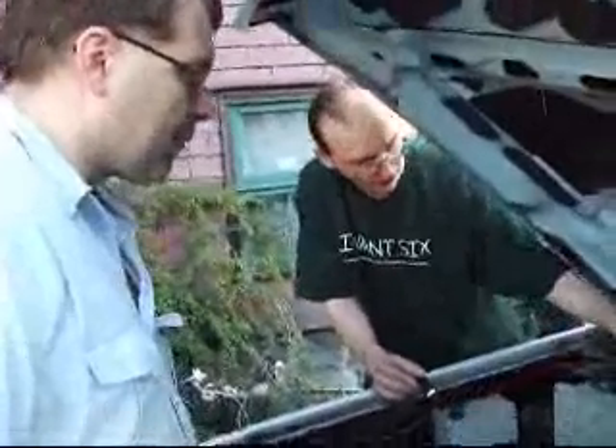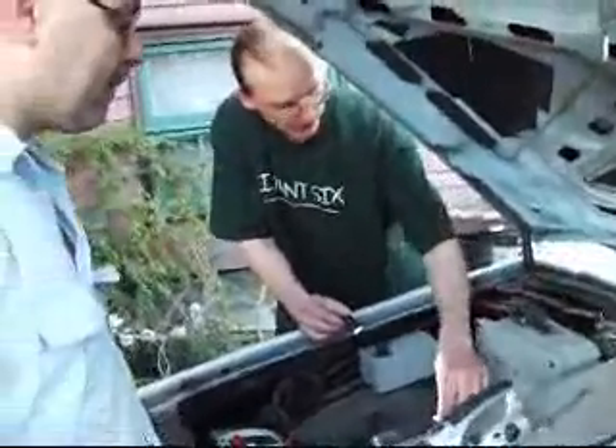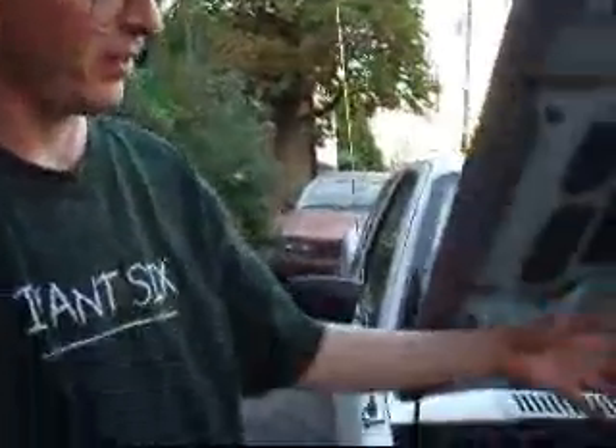The most expensive part is the motor and the controller, of course. You've also got a 12-volt system and a DC-to-DC converter. There's the motor — you can see it now. As soon as you let off your gas pedal this thing turns off, then it reads from the potentiometer voltage that varies with the throttle — that's its input. You've got a DC-to-DC converter that goes from 150 volts DC down to 12 volts to run your accessory battery for your headlights, wipers, all that.